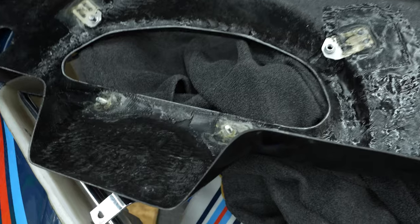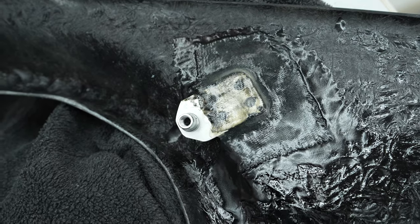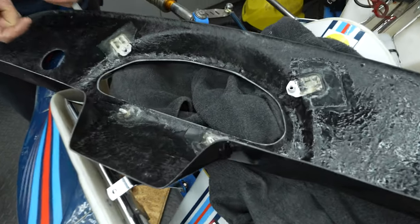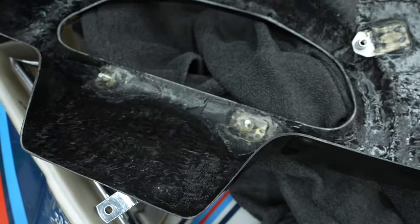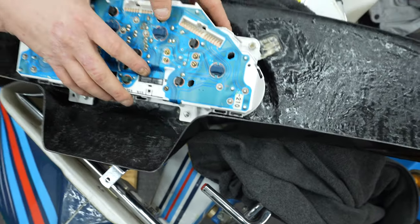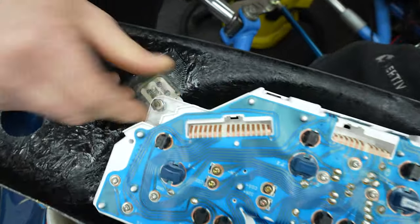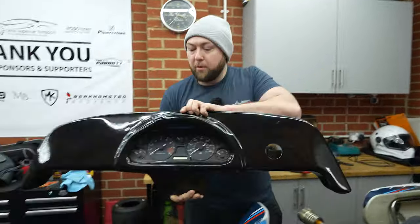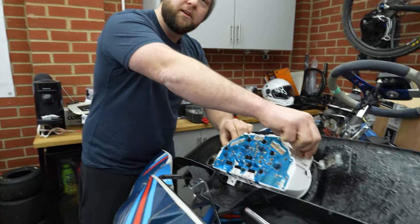What we've done, these two plates is just a bit of aluminium with some drilled holes so the glue comes through, and with some riv nuts upside down to catch a thread. And here we've got a little plate with a stud on that we got off eBay. I'll get Dom to drop a little link below. We're going to use them to fix the dash as well. But that just means that the clocks sit in, and then you can literally just put a bolt through. Look at that, and they just do up. And it's removable. We're going to make the whole dash pod fully removable. Nice and central, bit of U-trim around that. Nice little job that. Lovely jubbly.